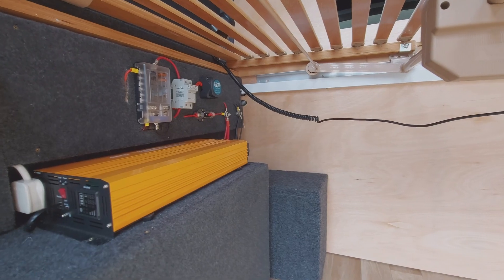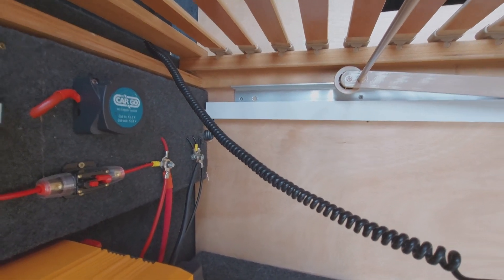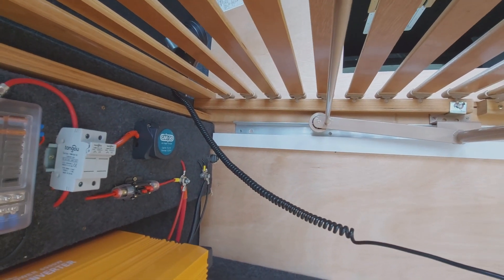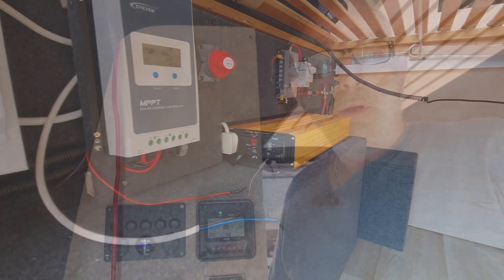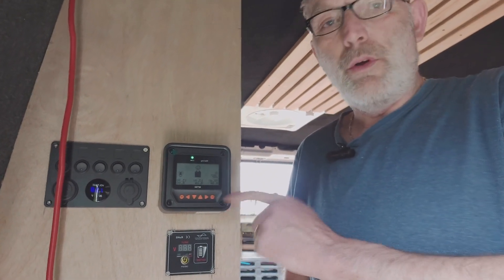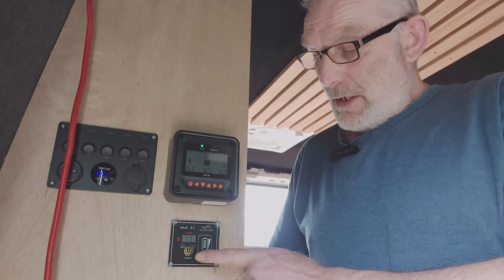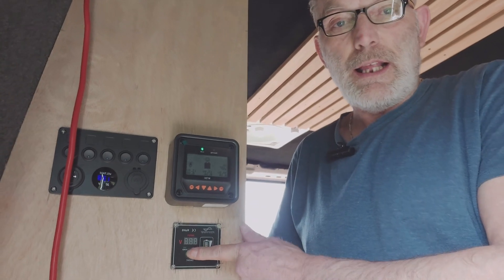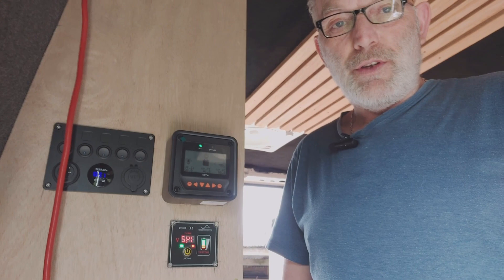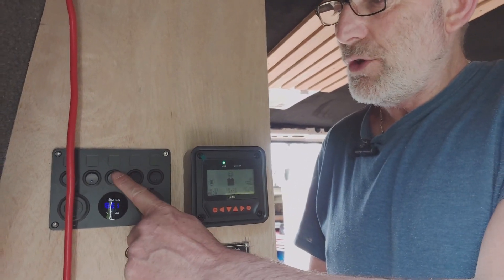So as you can see, all the wires go into the dividing wall between the bed and the living compartment to go to the control units. The white conduit going across the back is to take wires from one side of the van to the other, so everything in here can be accessed. This is the control panel beside me. This one here is the control panel for the solar, so I can see how much energy we are creating, what we're drawing, and so on. Underneath is the remote for the inverter — if I click that on, that will turn on the inverter, so now we have 240 volts. Over here are all my switches for turning lights on and everything else.